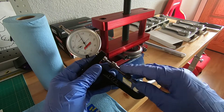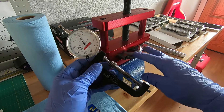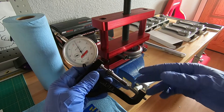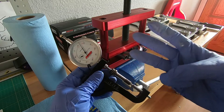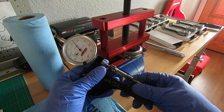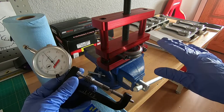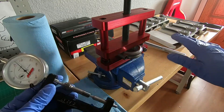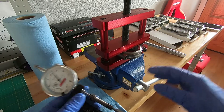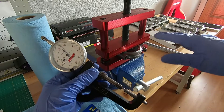This is going to be the first time — I'll torque these down now. When we put it in the engine to check clearances, that's the second time. And when we do final assembly, that's the third time, so it's going to be three torque sequences total. You can also do multiple torque sequences on ARP head bolts or head studs — just go through the whole sequence, torque everything down, loosen, and repeat. Some engine builders do the torque sequence three times on final assembly.